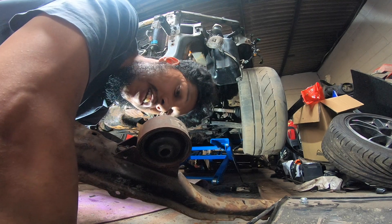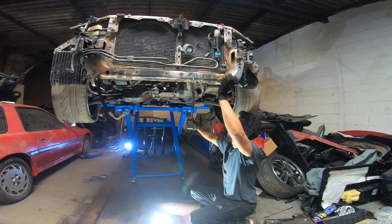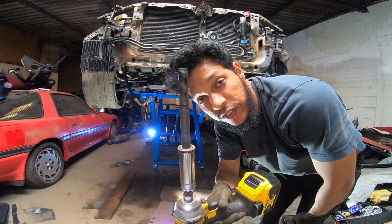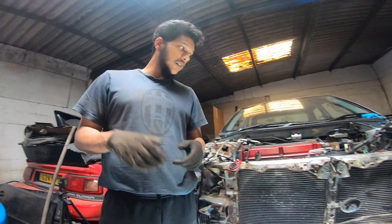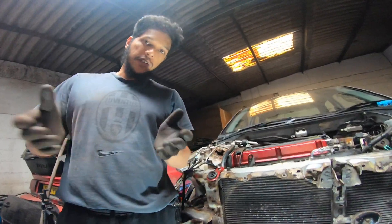That's a stock bush — it actually looks quite strong. We're going to tackle the front subframe bolt by bolt. Next one for the bottom one. We need to put a trolley underneath the engine so that when we drop the engine down, we can roll it out.